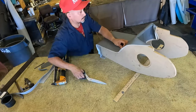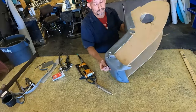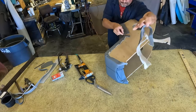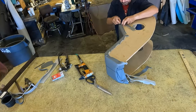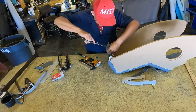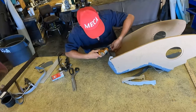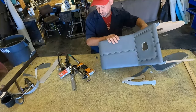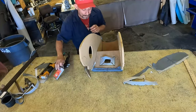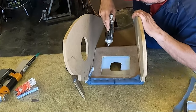Same thing on this side — I am not going to show you there, I already gave you an idea. I trim the vinyl because I don't want excess material in the way. I will finish the front and the back section of the center console. I will put glue right here because that is the cup holder — I am not going to cut it right now, I will cut it at the end. I am cutting the padding and then I will put glue and some staple later.